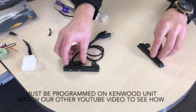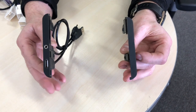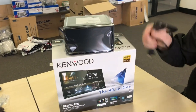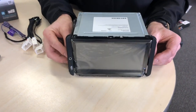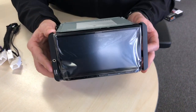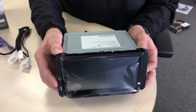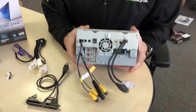Here's another cool inclusion. For those of you that don't get the widescreen units — the 200-millimeter wide units that come standard in the Toyotas — when you change to an aftermarket double-DIN stereo, it is a square unit and you have the rounded edges. So we're going to include these brackets — the Toyota wings that sit on the side of the stereo just like this. They'll actually fill the gap perfectly and give you AUX and USB there for running Apple CarPlay, Android Auto, or any other USB. That's very easy to do, and I'm going to show you how that wires onto the back so you can install it yourself.